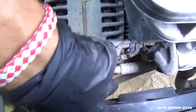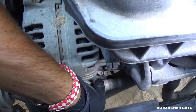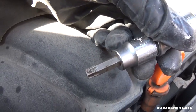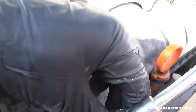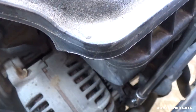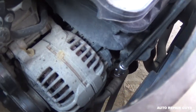Next, we'll be working from the top. The hoses are located here — one and a second one — fastened with a T45 Torx bit. In our case we don't have a T45, we have a T40, and we messed up the T45. Never do that — always get the right tool. But we'll likely be able to take them off with the T40, as we've done in the past. If you mess up the bolt, you're in big trouble.